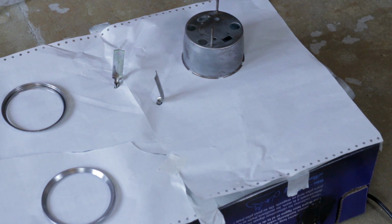So I removed all the coatings, the dirt, the rust and the paint off of the casing, the bezels and some of the clamps. This is the tachometer, the speedo is over there. So first I'm going to treat this with a rust converter and a primer. I'll let it dry, we'll do 2 coats. And afterwards I can go on with another primer and a base coat.